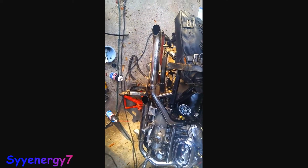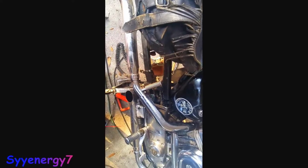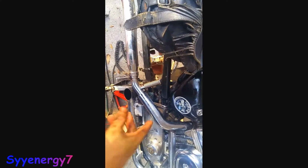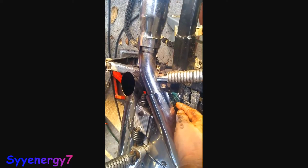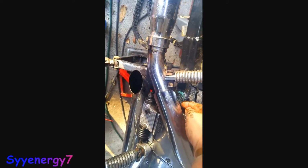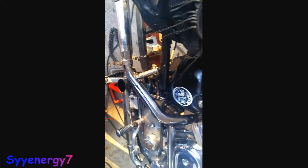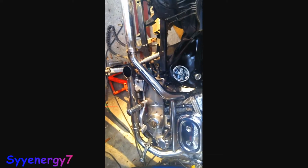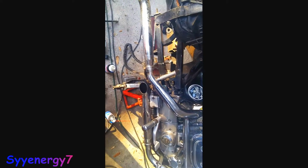because now I can leave the wheel on, maybe jack the bike up a little bit. If I want to inject some grease in there, I've got these two little notches behind this bolt. That gives me a place where I can pry this out and inject a shitload of grease in there every once in a while, and I can do that every 5 or 8,000 miles.